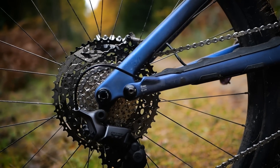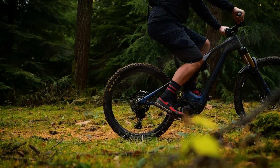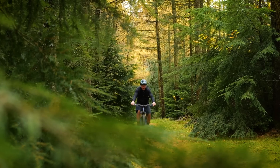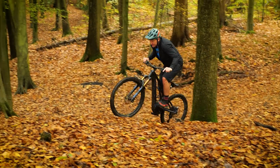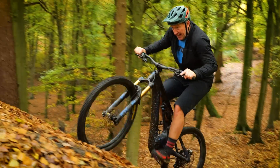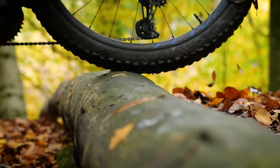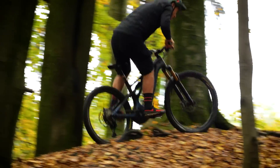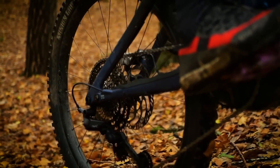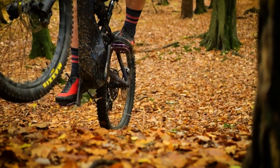The redesigned teeth on this cassette have a much thicker base and a unique chamfer that drastically improves wear resistance in high-torque applications. The robust cassette teeth really do resist damage when shifting and climbing under high-torque situations. And because of the redesign of the shifting gate, it creates a smoother hand-off between the cogs to avoid jumps, which is more pronounced on outward shifts where pedal shock is more noticeable due to the higher forces.